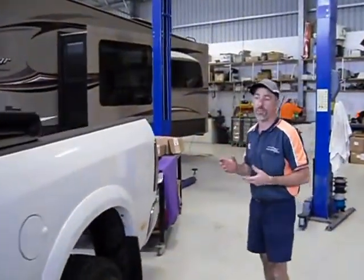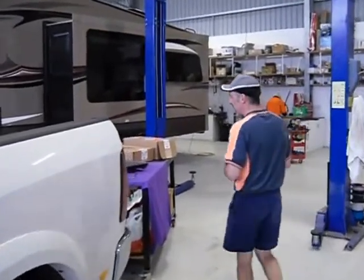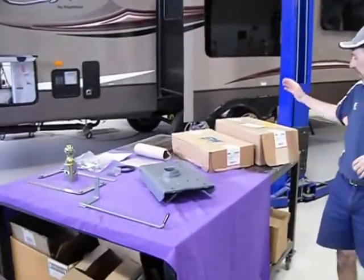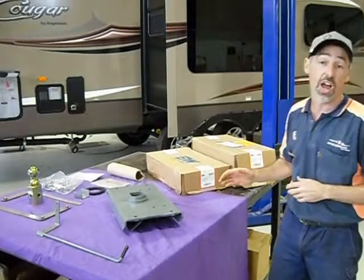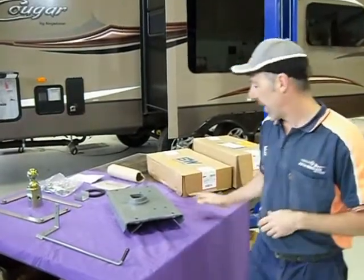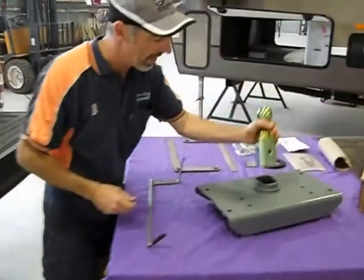They're a ripper truck. This is a short bed, dual cab model. It's a 2016. So today we've put in a B&W 1384 kit, known as a 3 quarter ton or 2500 kit. And it comes with the centre box, which the 3 inch ball mounts into.